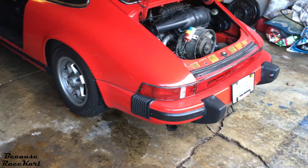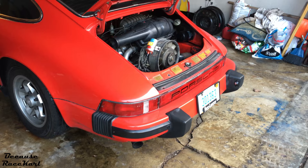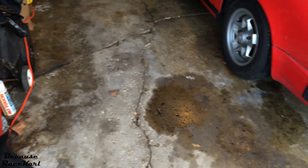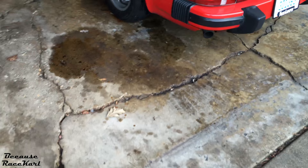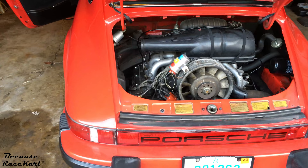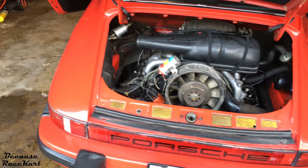I'm not sure whether or not I'll be able to record the valve cover gasket work, because I'm not sure how intricate it will be and I don't want to rush just to show you how it's done. So that part may or may not be in the video. Here's the valve cover gasket kit — it's got the gaskets and the appropriate nuts, bolts, and washers that I'll be replacing. And you can also see how much oil is on the garage floor — I wasn't kidding when I said it was leaking quite a bit. In order to do the valve adjustment, the engine has to be dead cold, so I'll drain the oil first after warming up the engine, then put it on jack stands and wait.